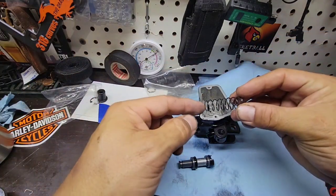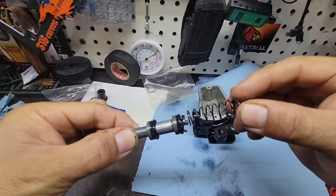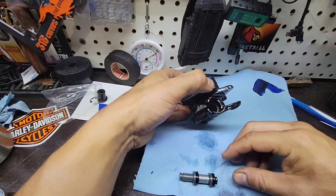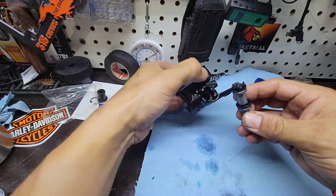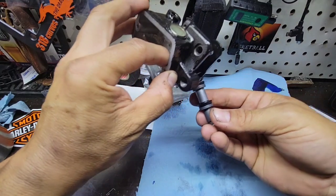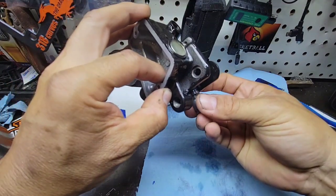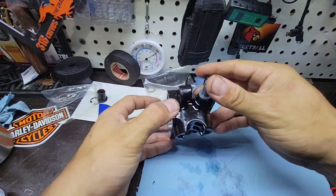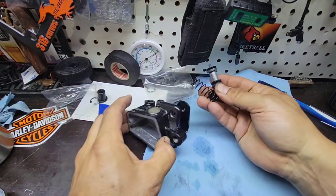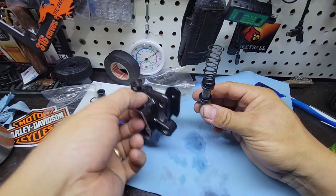And then the new spring, remember, it has two shapes. The smaller one goes to the piston because it's going to sit in this retainer. So what we are going to do is we're going to drop it. Then, in order to avoid it sitting incorrectly, I will return it and make sure that it's sitting correctly inside. So, okay, as you see, I made a mistake here, so just make sure you don't make it. So I will go back. I will put the retainer, I will put the spring, and then the body will be up.